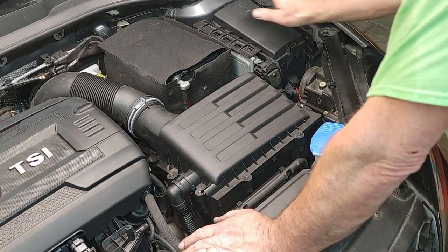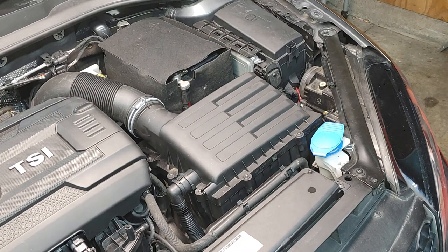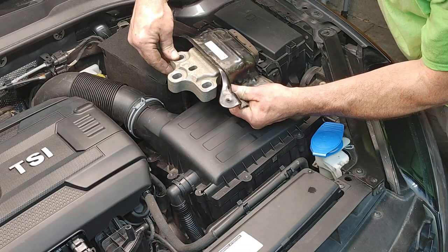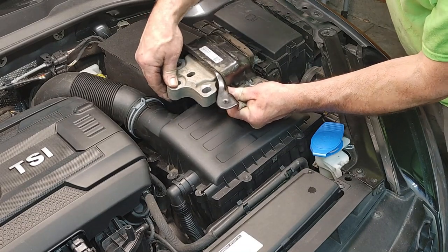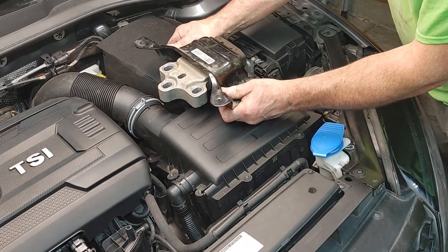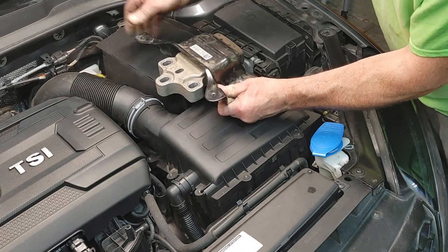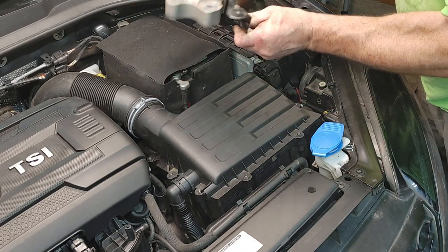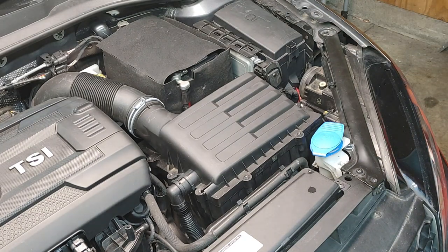Okay, so transmission mount fixed. Again, I'll show you the bad one. The nastiness. Why the car was going kunk kunk. So it was going that noise, or you could just feel it, like it was a delayed engagement. And that's because the motor was going kunk. So, bad. Okay, I'll start working on the other side, the easy one.